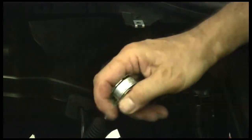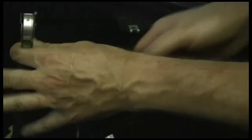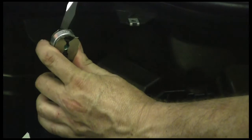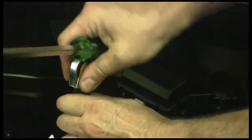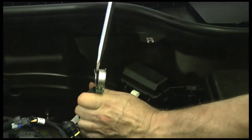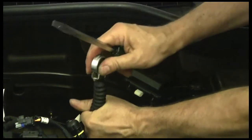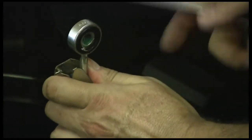Now we want to show you what we're actually working with. There's a little clip — you can see in the inside of this ball joint, the ball went in here, and this little clip retained it. When I had the screwdriver in here, all I did was release this and let it drive down. I know it's difficult to show you, but that's how it comes off. Once this is off, the ball joint is seated in here.